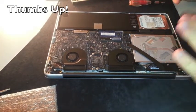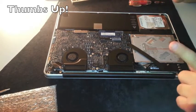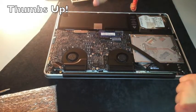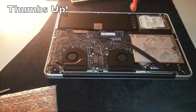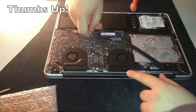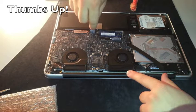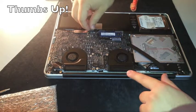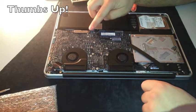This is actually the 15-inch MacBook Pro on the inside. The first thing you have to do is unplug the battery so you don't risk any damage. I'm also going to touch something made of steel on my desk that's grounded, to ensure there's no risk of destroying the motherboard with static electricity. Then remove the battery connector.